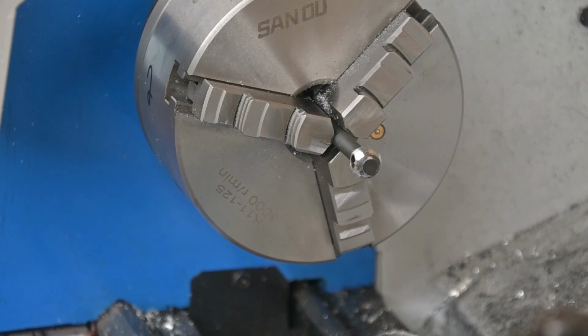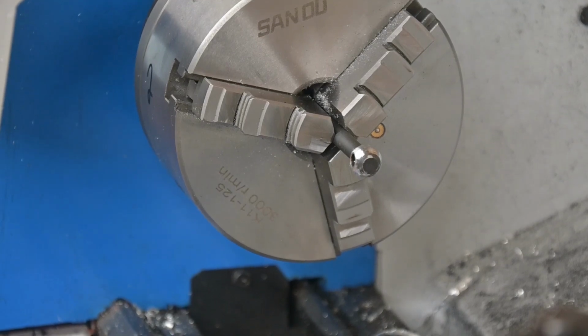So in order to get these stock rear Rovan out drives to fit with the hardened Chase cups and the new differential setup, I went ahead and knocked out the drive pins, and I got it in the lathe. I'm going to hand file the balls down to get them to slide into the cups right. Then I'm going to drill and tap the end for a set screw and set in a new hardened Losi pin and anchor it that way. I'll probably have to do the same with the fronts, but start off with the rears.